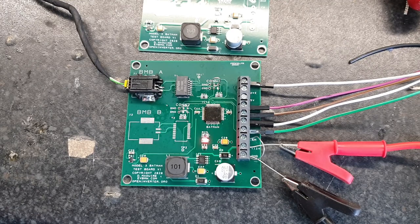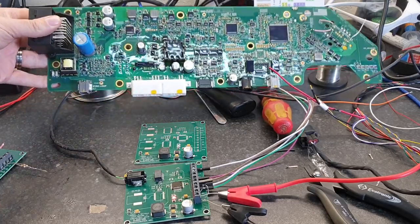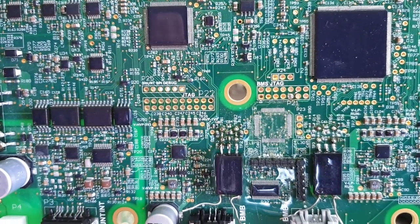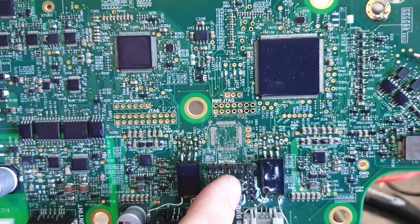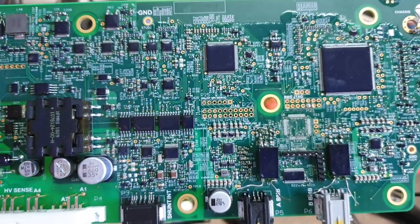We've a new board for you. In fact, we've been making quite a bit of progress on this thing while you folks have been away partying. When we last saw you, we were messing around with our Model 3 high-voltage controller. We were doing lots of fun reverse engineering work, trying to work out our communication between our Batman chip and this horrible NXP microcontroller. And Elon had thoughtfully provided us with these little headers here where we could logic analyse the signals.